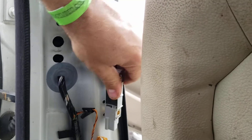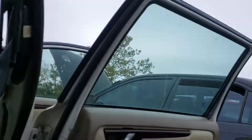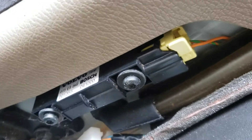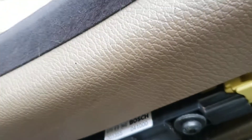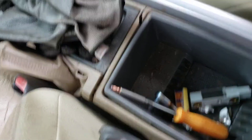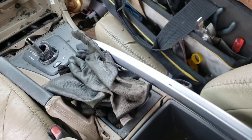The front sensor goes up here, and then the rear is behind the C pillar — that's where that one is located. Your SRS control module is underneath here, and you'll need to get it reprogrammed supposedly if you have an accident.